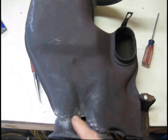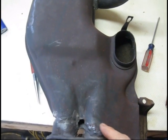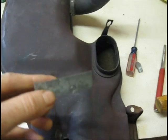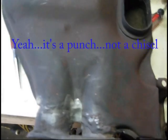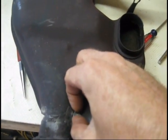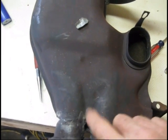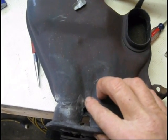We've got this huge hole right here that I can't weld because it's so thin from all the years of heat and exhaust, plus weather and water splashing under the engine. What I've done is take a little piece of galvanized metal — just a scrap piece — laid it flat up here, then used a chisel and small hammer to tap and form it into place. I'm going to take my JB Weld, put it all around the hole, set this formed piece in place, and put a coat around the edges.